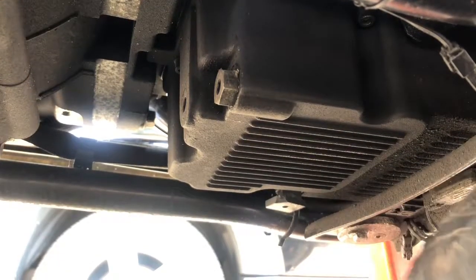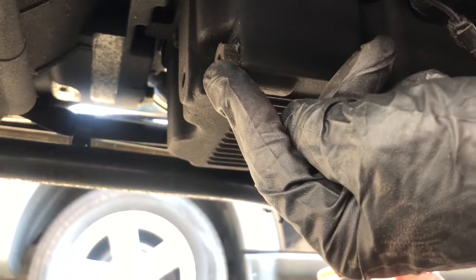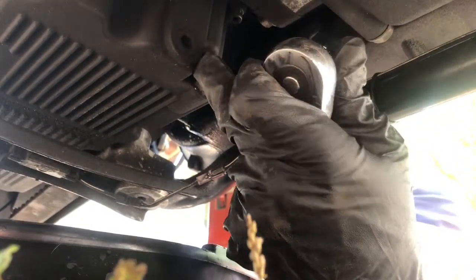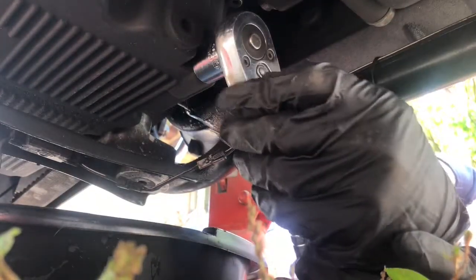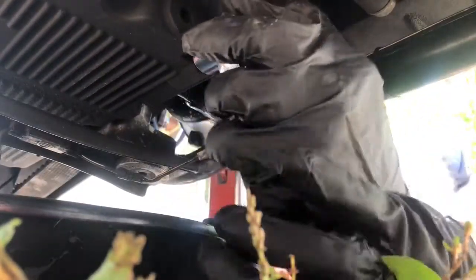The first process is after you're warming the motor up. Underneath on your left-hand side of the bike, below the primary case, you'll see the oil pan. The drain plug is this 5/8 directly in the front. Now that we're under the bike, the location of the drain plug is right directly in the front of the pan. Put on your 5/8 socket — it's not on too tight, so it should just be a light twist.